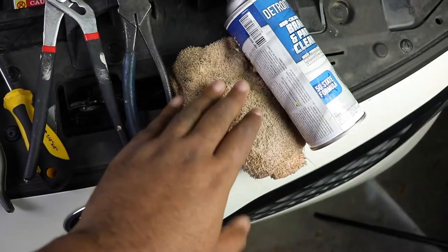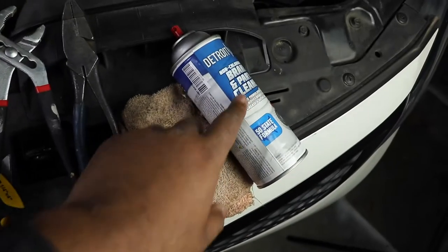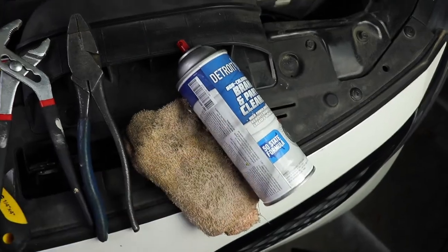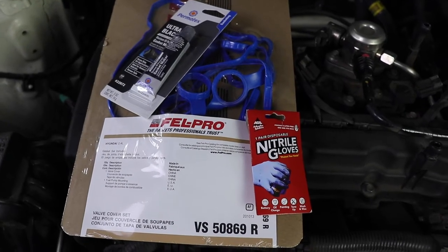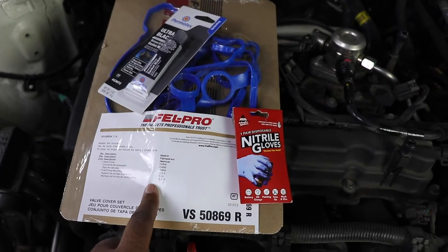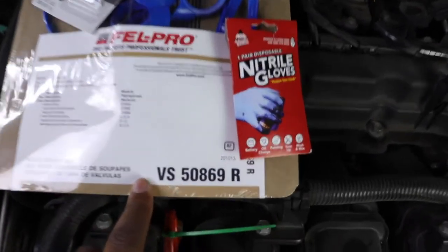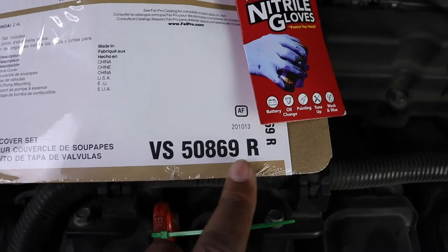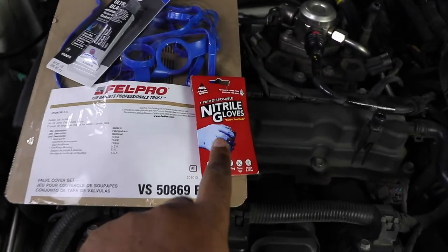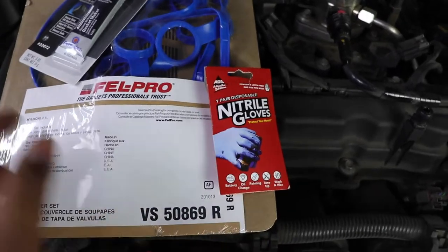I recommend having some type of rag, definitely brake cleaner, because you are going to have to clean the surface of the valve cover. The part that you need to do this job is a valve cover gasket kit. I will put the link to this kit in the description below. This is the number for the kit. I picked up some gloves because the job might get dirty.